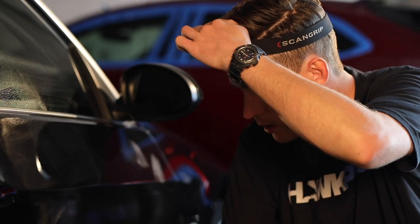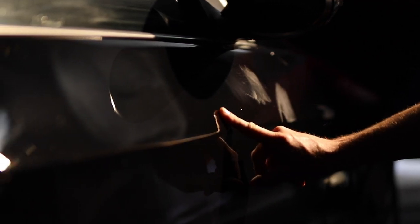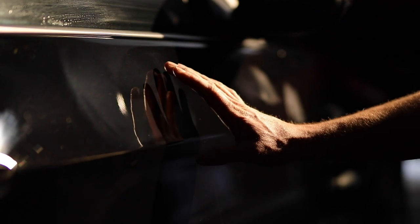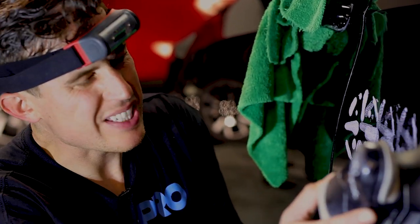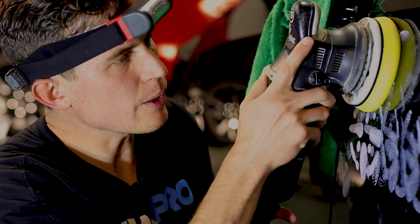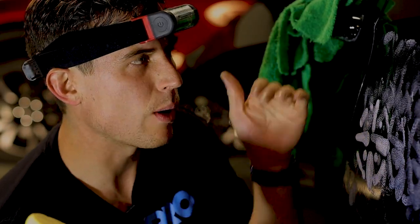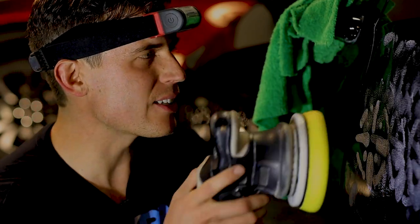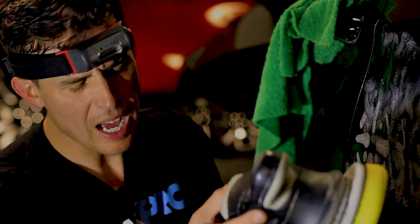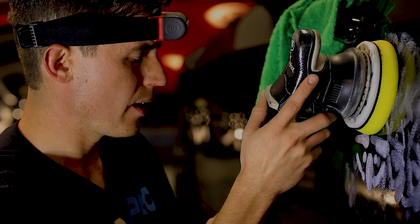What you see there is haze. Here you've got a sanding mark where I sanded this way, here you've got the paint that I haven't touched yet, and right here you've got the paint that I've compounded to remove a sanding mark. We're still going to polish this and it's going to look way better. What I'm focusing on in this first step is just trying to get rid of the haze and ticks — I'm not going for perfect tick removal. I see some areas that maybe I didn't compound out perfectly, but I think I can get away with it. You want your upper panels to be really dialed in, but from below it's sort of a judgment call. I might throw my polisher up between four and five with a little bit of pressure — it's to remove all the haze, not quite getting the perfect finish just yet.